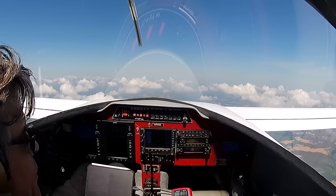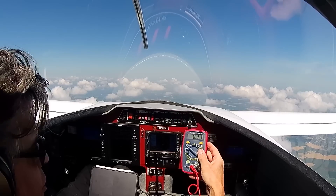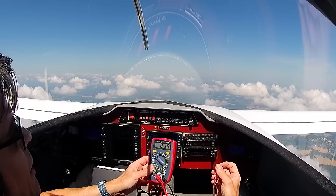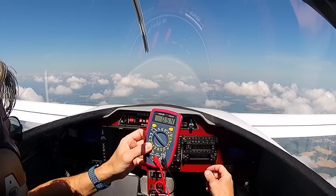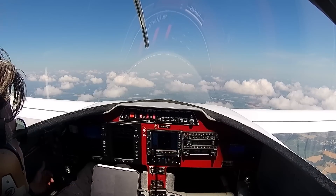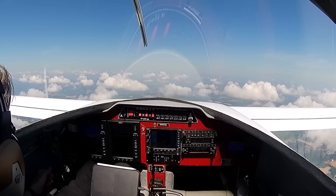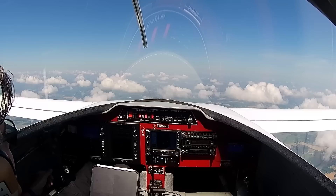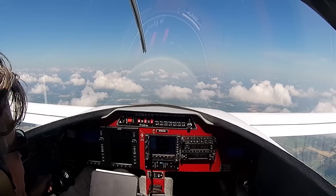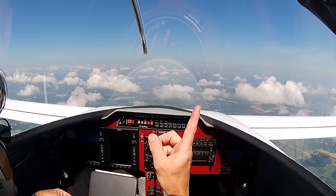I have this meter set up here that tells me the advanced timing on the EIS — currently showing 38 degrees. I also put in a switch so I could turn off the manifold adjustment. When I switch it on, the timing goes to 54, and all of a sudden my CHTs start climbing like crazy and my power goes down. So I switch it off, CHTs go down. I'm climbing at full power and I'm only at 375 degrees. Obviously my EIS is not working correctly — the timing is not set correctly.